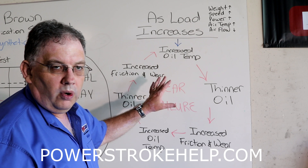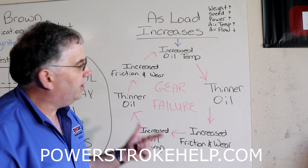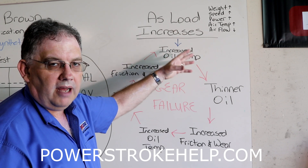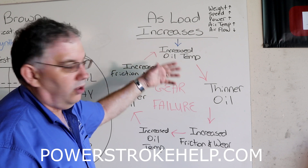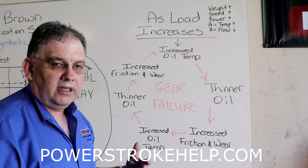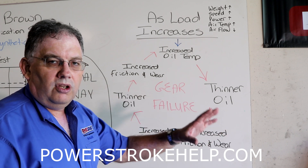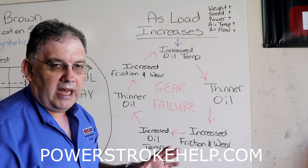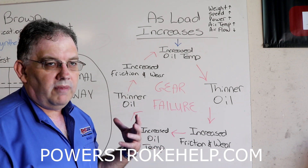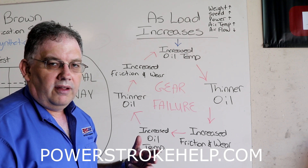That's what we're trying to avoid. The way you avoid it is with proper maintenance of your rear differential, including proper fluid, and operating the vehicle within the parameters it was designed for — unless you have made modifications like putting in a larger differential or coolers. You cannot just add more power to your truck and think it won't have a dramatic negative effect on your differential. If you upgrade the engine, you have to account for loading it to maximum capacity and make adjustments. You may have to put in a larger differential or a cooler. Mainly, you need to stop towing things with an F-250 that an F-650 was designed for.